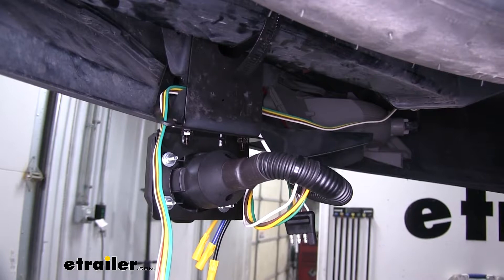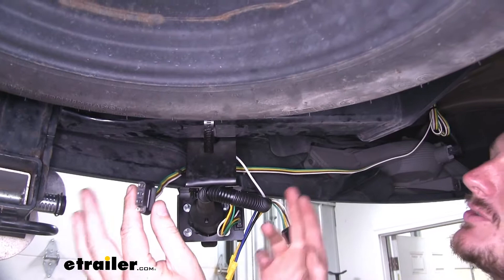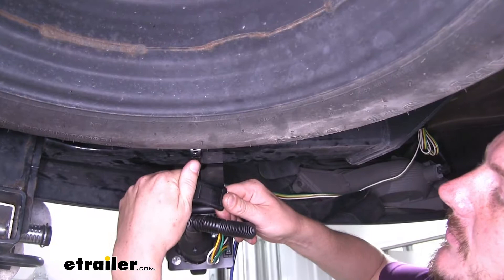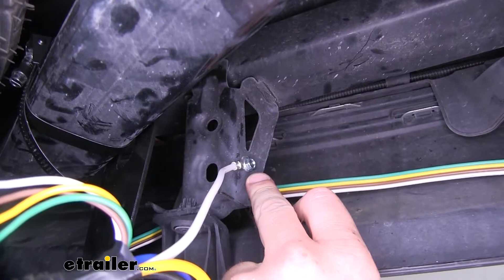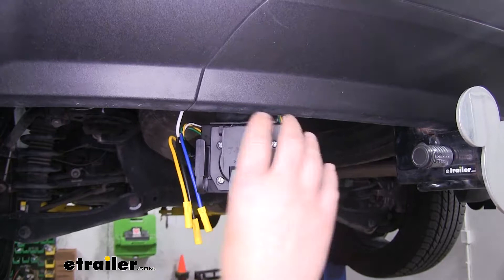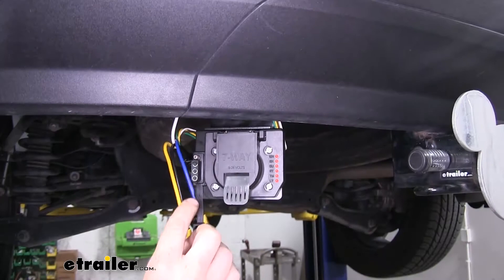If you're going to be using this just to take your lighting from the existing four-pole connector so you can use it with a seven-pole, all you have to do is plug it into the harness coming out of the back. We plugged our factory four-pole into the four-pole off of our new harness, then take the white wire coming out of our harness and use the included self-tapping screw to connect it to your frame or anywhere that's metal and grounded. If you're just using it for your lights, you're all done — those three remaining wires don't need to be connected, and you'll have all your lighting signals at your seven-way as well as the four-way conveniently at the back of the vehicle.